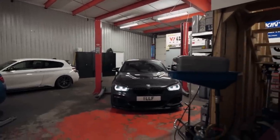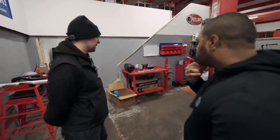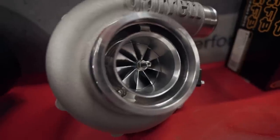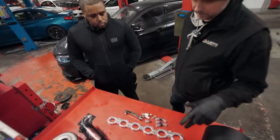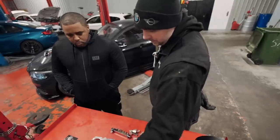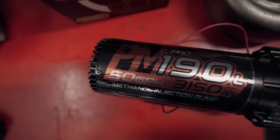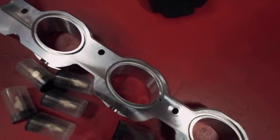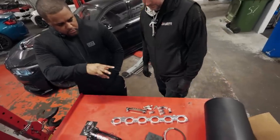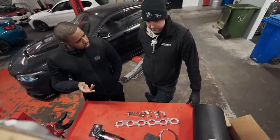As you can see we've got the M140 here. We're going with the turbo upgrade and maybe build the engine at a later date — see how it goes on the standard engine first. The main part is the Garrett G35-900, rated to 900 horsepower. That'll be on a COB Developments turbo kit — manifold, downpipe, screamer pipe — with a Turbosmart wastegate controlled by a GFB boost controller. We've also got the new Frostbite methanol controller, fully mappable to boost and RPM. We're running a high-flow pump with high-flow solenoids so we can run size-seven nozzles instead of the usual size-threes or fours — more meth, more power. Three-gallon tank, about 12 liters.